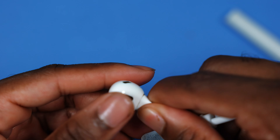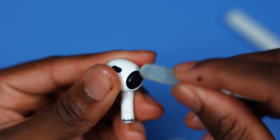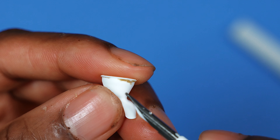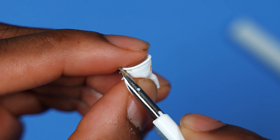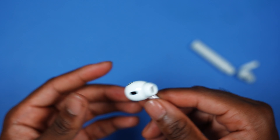Sometimes it can get even worse — you may want to remove the silicone tip because so much gunk can penetrate through the speaker module or speaker grill. Use the brush to brush everything out. If it's really bad, you'll find gunk around the silicone too — you can use the needle with the pointy part to just needle it away.